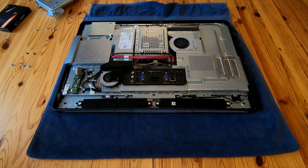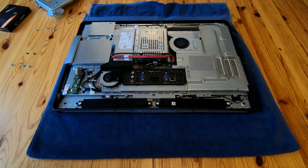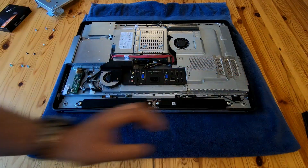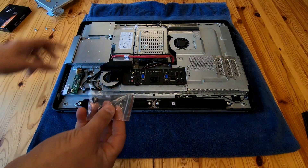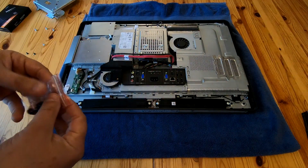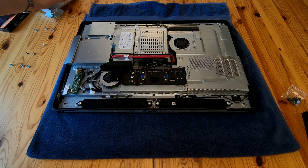The drive is fixed in there — it's quite a dark rainy day but hopefully you can see it. Another problem is that all SSDs are two-and-a-half-inch, and a lot of these devices came with three-and-a-half-inch drives. You can buy little adapters, but they often aren't designed for this specific caddy. In this particular machine, the SSD has to be positioned on the right edge because that's where the hole is for the data and power cable. Plus there are hard drive screws with rubber grommets that have to line up, otherwise the heavy back plate won't fit.